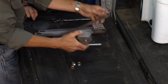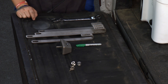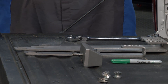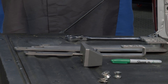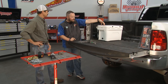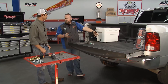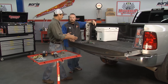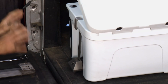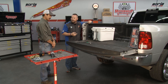We were in the oil field and had a handful of coolers stolen and finally got tired of the thieves. The genius here is the fact that there are slots in the cooler designed for ratchet straps and tie-downs — and that's a super strong and great way to introduce this product. Both pieces are 304 stainless steel — this is cast out of 304, this is bent out of 3/16ths thickness — all made in Texas. With stainless, it's going to weather fine no matter what your environment is. And when we talk about installing this, we're going to drill one hole and tighten up one nut — and that gets us not only the security of the cooler, but also keeps it from rolling around in the bed of the truck.